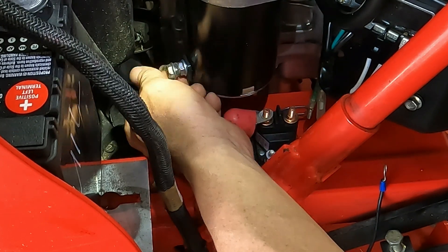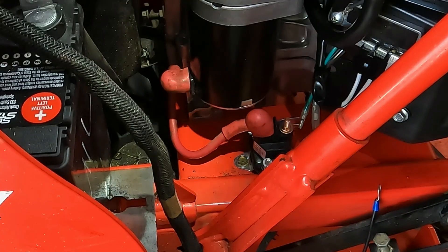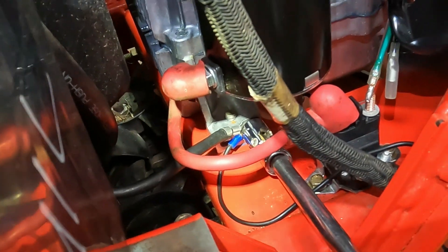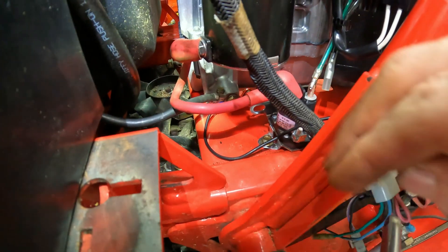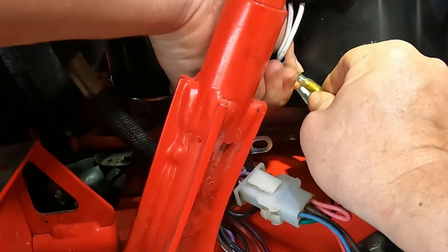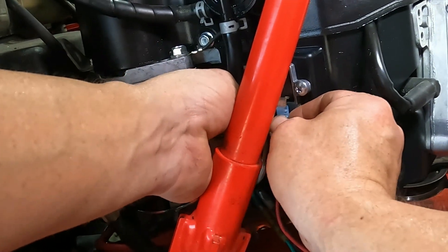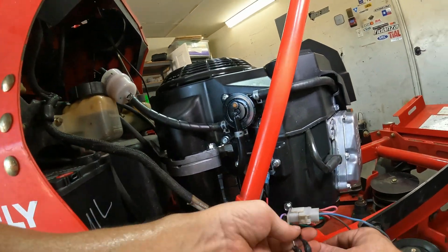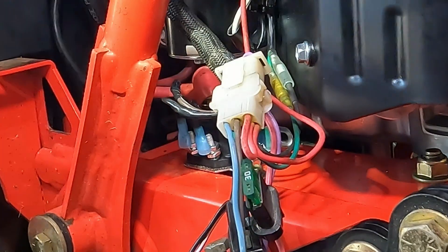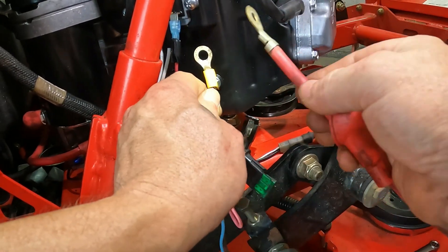One side of the starter solenoid has to go straight to the starter — 11 millimeter here. Alright, so that's one half of the solenoid. We're going to be putting this ground screw in that hole. This is the battery ground, and this is the ground for the harness. Next thing we're going to do is ignition — just want to make sure they're snapped in. Next one's going to be the charging circuit — it's on there pretty solid. These go to the solenoid — the ones we prepped earlier. On these it doesn't matter which one's positive or negative, you can have it either way. This is the charging circuit. Fuse — 30 amp — looks good. This goes on the other end of the solenoid, going on top.